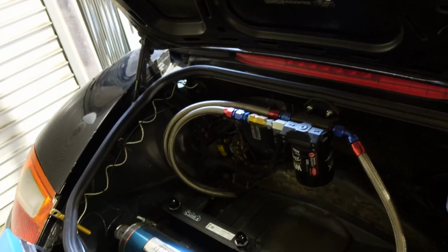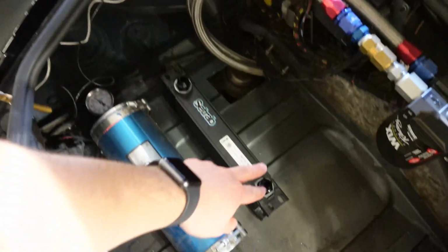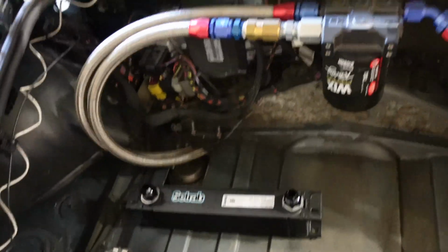And if we come over to the back here, because we are running in the heat, I want to install an oil cooler. So what I'm gonna do here is split the line here and then run it through this side and this side, and then this little small thing alone, you'll be surprised of how much this helps. And then I want to find a way to get some cool air through there, not just sit here in this tub of heat. So we gotta figure that out.